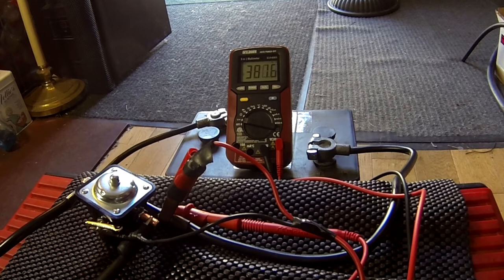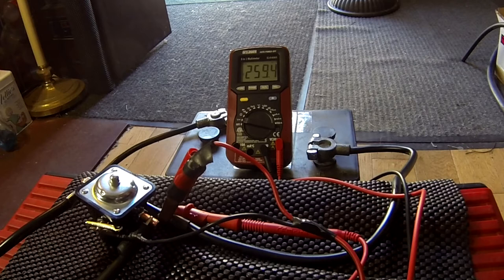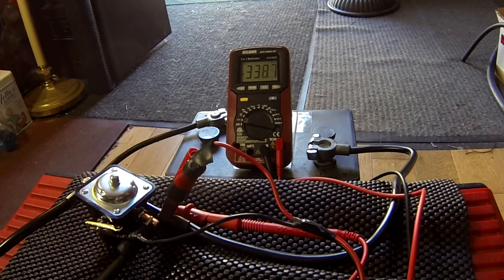We quickly got it running, but we could not start it from inside the car. We had to press a little button on top of the ignition solenoid to make it happen. It was like the frequency was getting cut — it would turn the engine over but in increments, not smoothly. The solenoid was only sending power intermittently. With our finger we could hold the solenoid closed, but the battery was not able to hold a 6-volt solenoid closed enough to start the engine. That was the assessment.